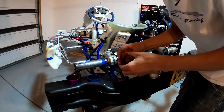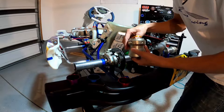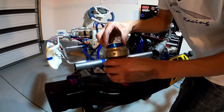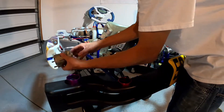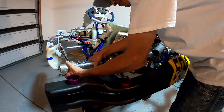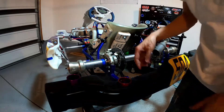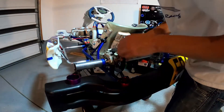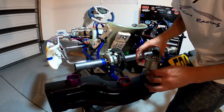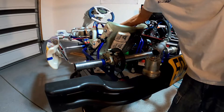I highly recommend getting these spacers — they make it real nice, easy, and quick to make these changes. For example, with two spacers in now, if I wanted to increase the track width just a little bit, I could slap another one in, slide the hub on, and increase my rear track width. If we're jacking too much and need to go wider, just add or remove spacers. Definitely test this to find where your cart likes to run, depending on tire compound and how many carts are at the track.